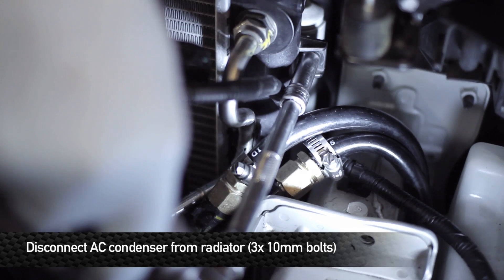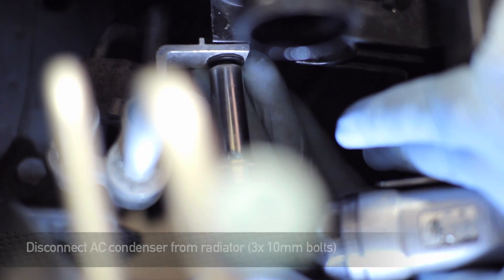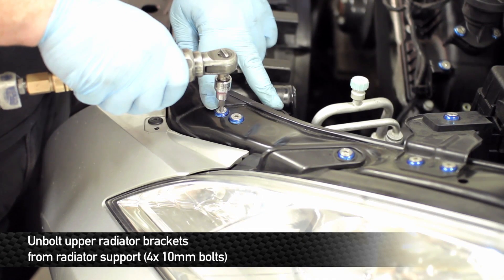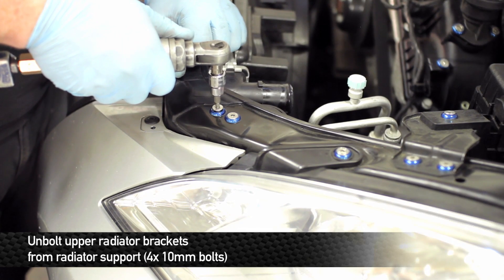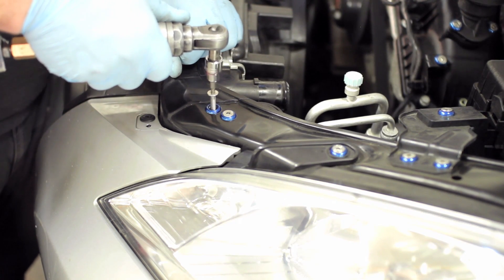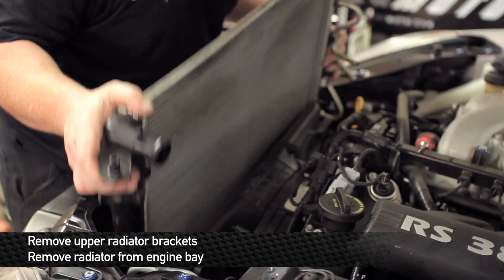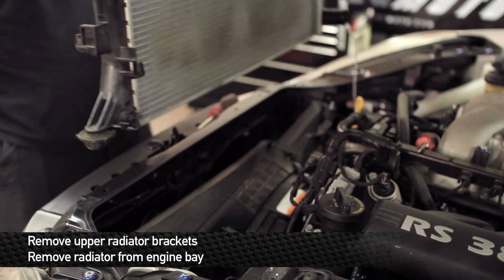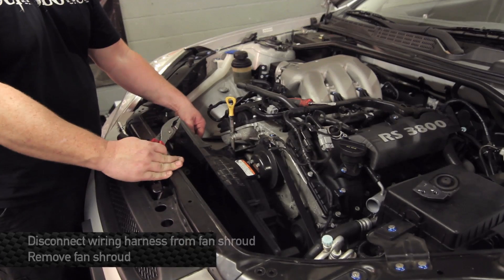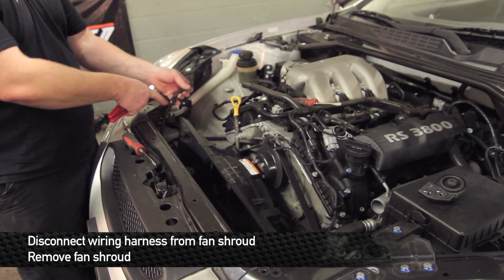We're almost ready to remove the radiator, but we have to remove the AC condenser bolts first. This Genesis owner has changed all the bolts from regular heads to Allen heads — on a typical Genesis this is a 10 millimeter standard head bolt. Remove these two upper radiator bracket bolts and the same on the other side. Remove the upper radiator stays and pull the radiator out, being sure to unclip the AC condenser from the radiator on its way out. Now that the radiator is out, we can get access to the back of the wiring clip inside the fan shroud — squeeze that together and remove the entire piece.